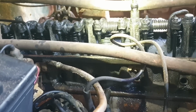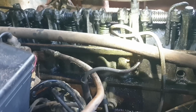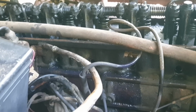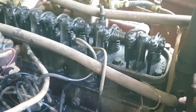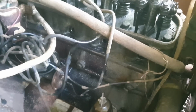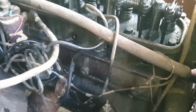Like I said, the exhaust valve is definitely open. Oh, it's on the exhaust stroke. I think that's the culprit. But being that the exhaust valve is open, that means she's right at the top of the stroke, and there's not a lot that's going to have to be polished. I can see the piston; it's not that far. It's just a matter of pushing it through that.